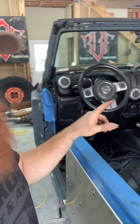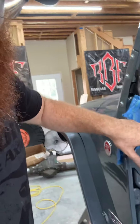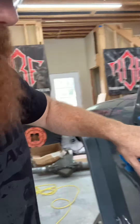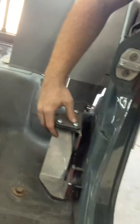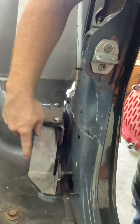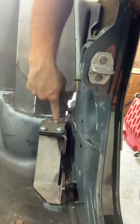We have a Genrite cage that we'll be working on next, before we get to any axle and suspension stuff underneath. You can already see the dash bar that's already put in — that takes a good bit of work to get all the holes drilled, hardware put in, and the dash bar installed. That basically locates the rest of the tube. The A pillar is set, and the B pillars end up landing right here, capturing one of the seat belt bolts.